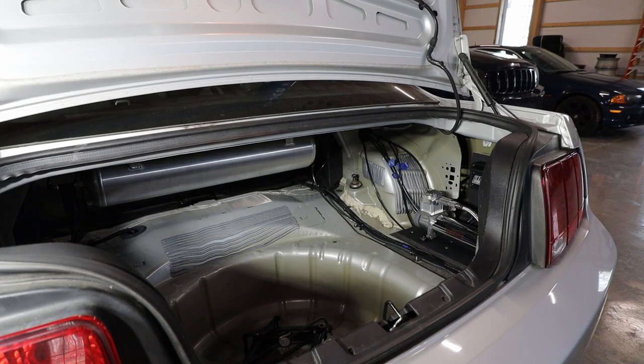So now it's finally time to put the wheels back on. I think I'm going to also put some air into the tank manually. That's kind of suggested just so the compressor doesn't have to fill it from zero. And then I think before you put it on the ground, you're supposed to power it up and make sure the bags have at least like 50 PSI before you put it fully back on the ground.